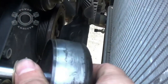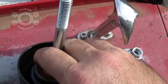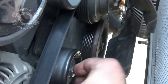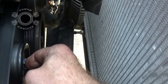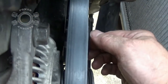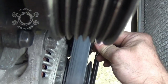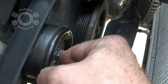I pulled it out and added one more washer, fed it back through — holding my finger pushing in on the bolt, turn it, spin it. Now let's check the belt alignment. I'm looking at the edge of the pulley — yeah, I'm centered really well. Actually, the wear mark that's in the pulley — I am perfectly lined up with it.